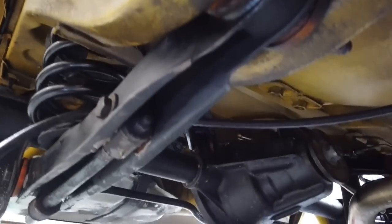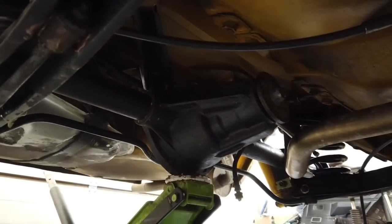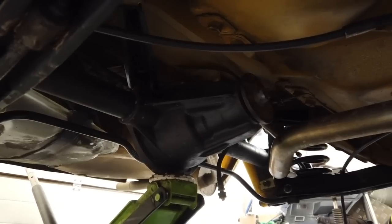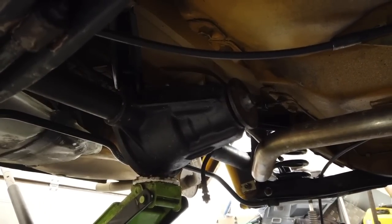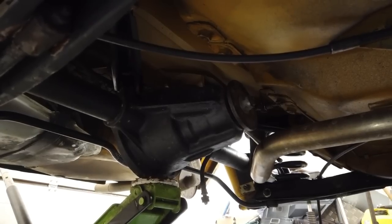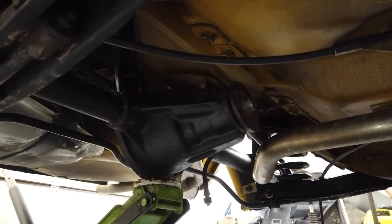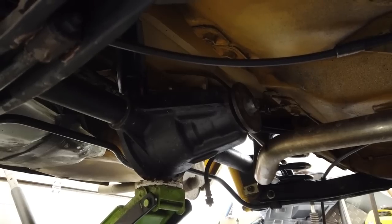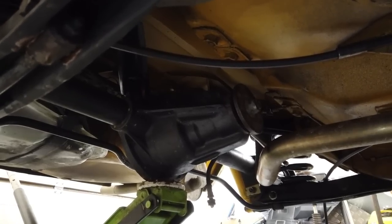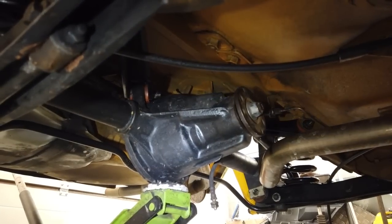Because of course, as you can imagine, when you load the car, the axle does change its angle. And you would think, how can this be? If I've got a fully laden car, will I not get a noisy prop shaft? That is true, that does happen. But the idea would be that it would be working unladen at, say, 0.5, and then laden at 2 and still be in its operating zone. Indeed, if you drifted to 2.5 angle, you might still be okay and not get drivetrain noise. But once you start drifting to 3s and 4s, you're going to get whipping on your prop shaft.